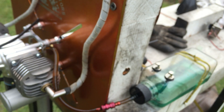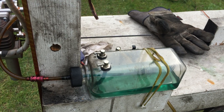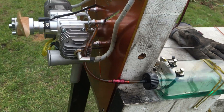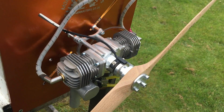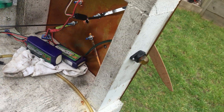The fuel is not the right mix for this — this is my converted engine fuel, 20 to 1. I'm happy with that. It's no problem if you run a bit rich for now because it's still breaking in. It helps to seat the bearings nicely.